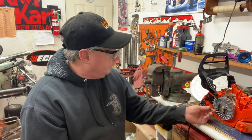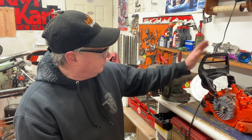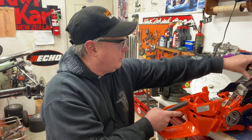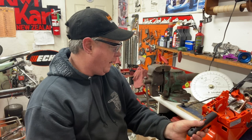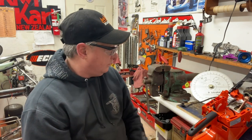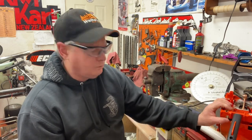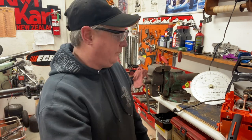It seems to work well on other models, so we'll see how this one works. It has a digital ignition — I can't remember the exact rev limiter but you'll see when I get this back together. Nice chain brake, very heavy duty plastic chain brake — looks like it would stand up pretty good, hopefully it's not too brittle. I don't know the capacity of the gas and oil, I'm sure it tells in the owner's manual. Typical old-style toggle switch — never seen them really go wrong. Same sort you'd use on an old 2100, Husqvarna, or old Stihl.